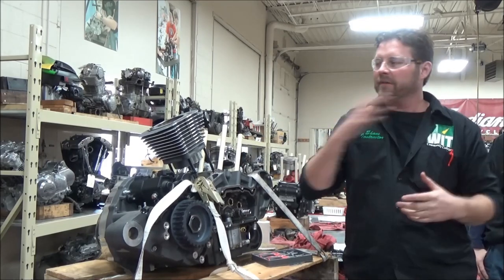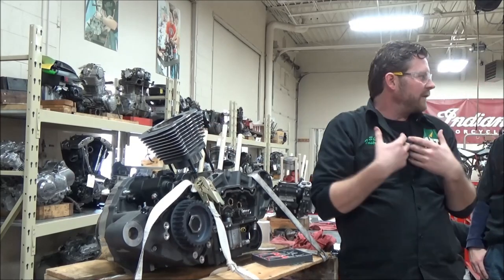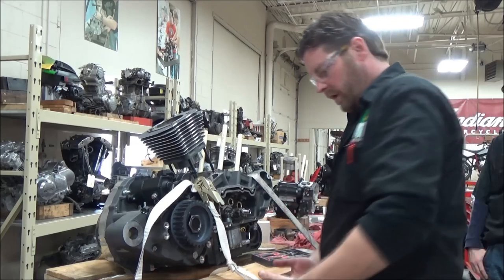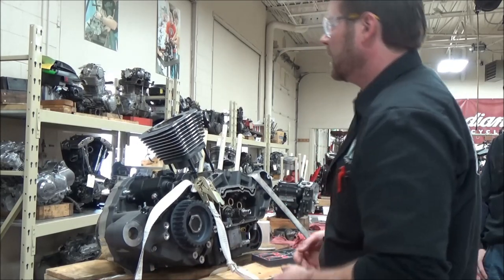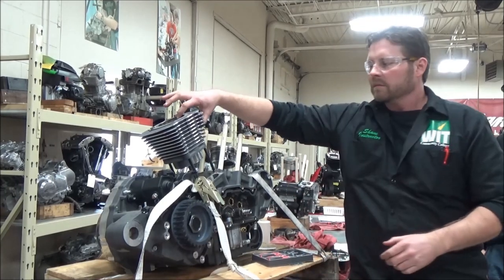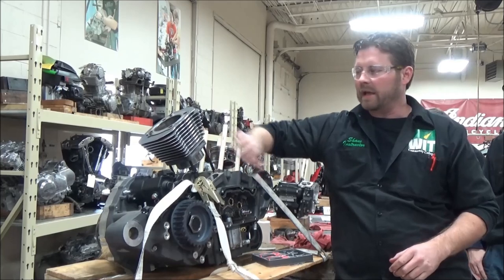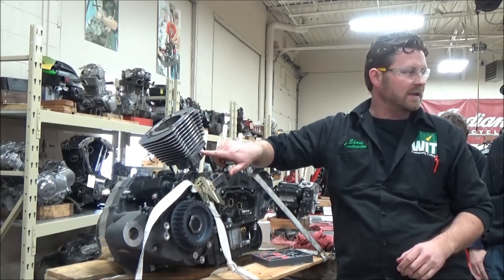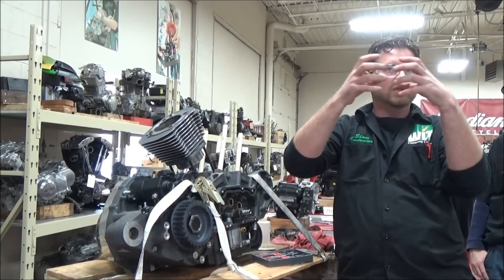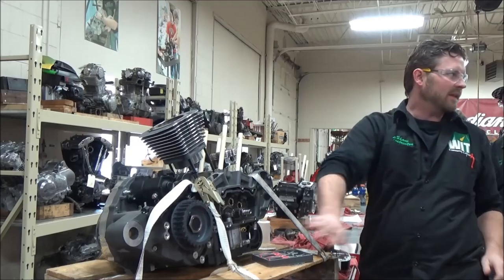I don't know about you, but for me, I like doing this because I just have a real good feel to it. I feel like I'm completely in control. When I'm working on the bench here and I walk the piston in, I just feel like I'm in control. It's a little risque, I guess you could say. When you go to put the clip in, you can't bump the cylinder, and you're also dancing on a really fine line, like you saw in the picture, that oil control ring is just ready to pop out. Just a method, that's all it is.